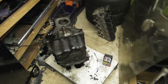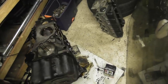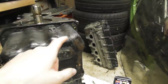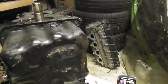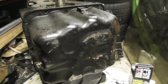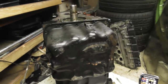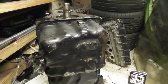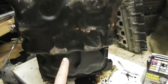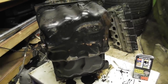Back at the other garage, I've turned the engine over just so I can get the sump off. That's the original tin sump from the Rover 800. It's got some fairly chunky looking dents, scrapes and scratches and a bit of rust as well. So I want to swap it for a nice alloy one from a 620 Ti, which I think is a little bit shorter in depth, which means I shouldn't get that kind of road rash scraping along and the risk of shattering my sump.